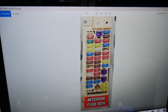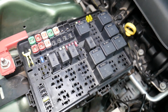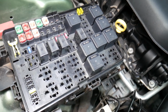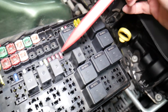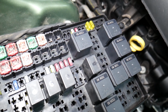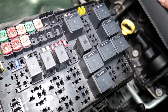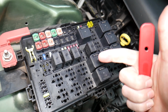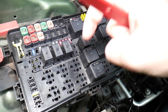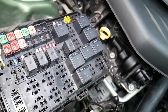Open it and underneath you'll find the interior fuse box with a layout that looks just like this one right here. Before we continue, let's explain quickly why it's always a good idea to test fuses and relays. It is super important to always test fuses and relays, and avoid a common mistake people make. Sometimes you may think that a fuse is good, or you cannot actually see if the fuse is clearly burned, and in that case you may put the fuse back and end up spending money and time on parts you don't need, when all we had to do is just test the fuse. We'll put a link in the description of the video below on how to test the fuse. It takes only a few seconds to find out for sure if it's good or bad.